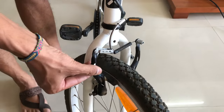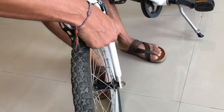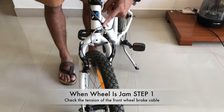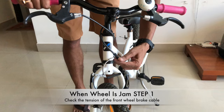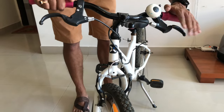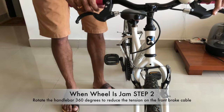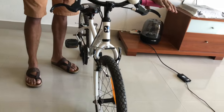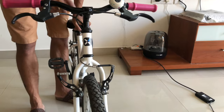The first problem is that the brakes are completely stuck and the wheel doesn't move — you can see the brake pads are completely stuck to the rim. The first thing to notice is the wire going from the lever to the brakes. The tension on the wire is very high. What has probably happened is the bike fell and the handlebar got twisted 360 degrees. Simply rotate the handlebar back 360 degrees and the tension on the wire is reduced — the wheel is now moving. Just check the wire tension and rotate the handle 360 degrees and the problem is fixed.